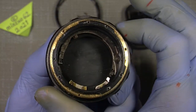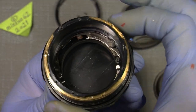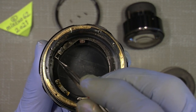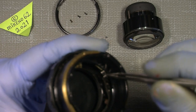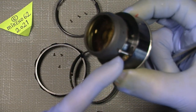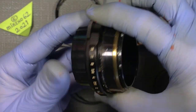You can put it back on and see the lens is actually working as a de-clicked lens. The arm that activates the aperture in the lens block is spring-loaded, so it will always push the aperture pin back on the lens assembly. Now we can just put things back in again.